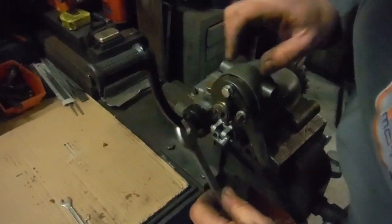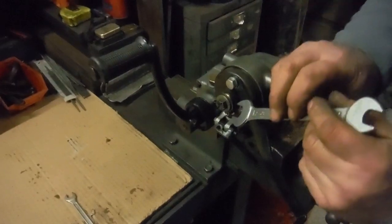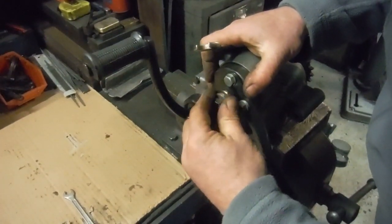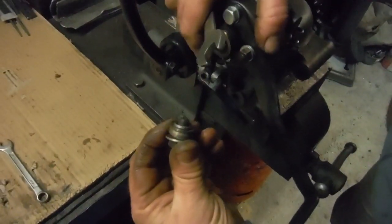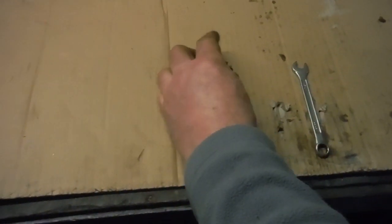I'll take this off and click through the gears — as I turned that with the spanner, that's not a worry. I had to make the spacing just right on this so that I could have the gear lever moving without binding, so that's a critical length — all that lot stacked up on that bolt there.